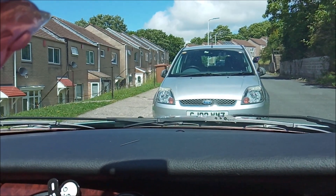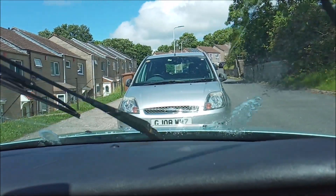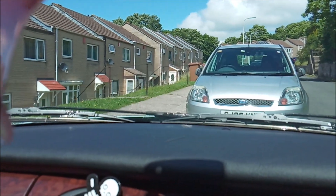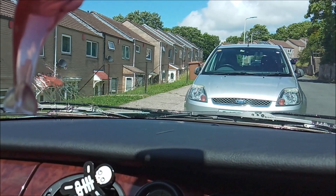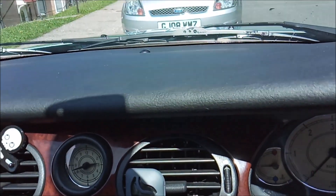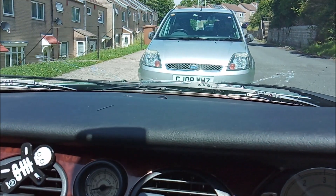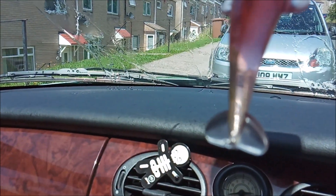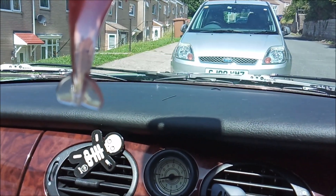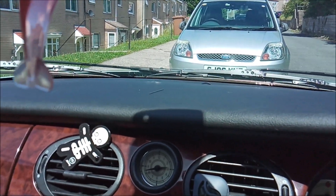Okay, so I'm going to turn the car on and turn on the washer jets so you can see how bad it is. There's only one hitting the windscreen and the other one is also missing - the two inner jets are pointing low, so they need to be raised. One is literally spraying against the bonnet. I'm going to adjust those. Right, let's give this another try - it only needs to be adjusted very, very slightly. Well, that's better on that side, definitely, and on the other side - yes, that's much better.